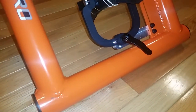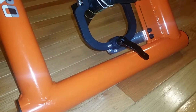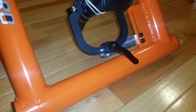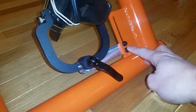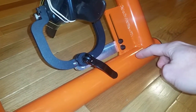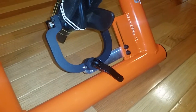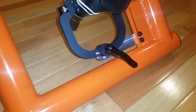As you'll notice, there's two different holes, and we included both of these just to give you options for how to space out the resistance unit to make sure you get the right orientation with your bike. There's a fair amount of adjustability built into these bolts, so if you loosen them, you can slide up and down easily. But if your wheel is outside the range of those, as some wheels will be, then you may need to actually swap the holes the resistance unit bolts into.